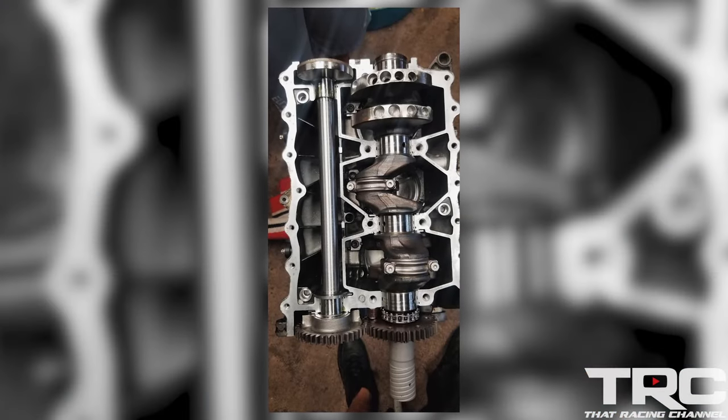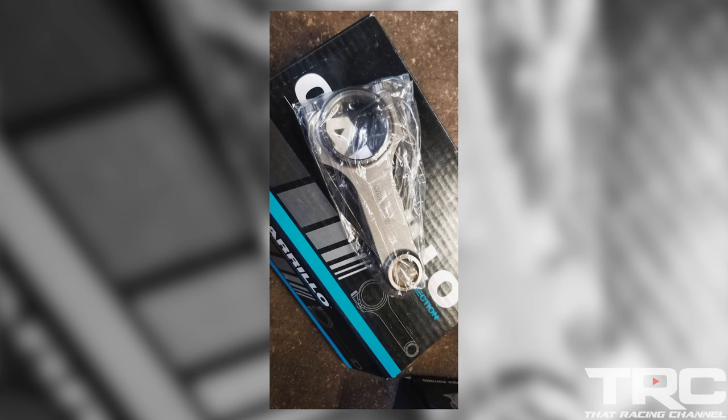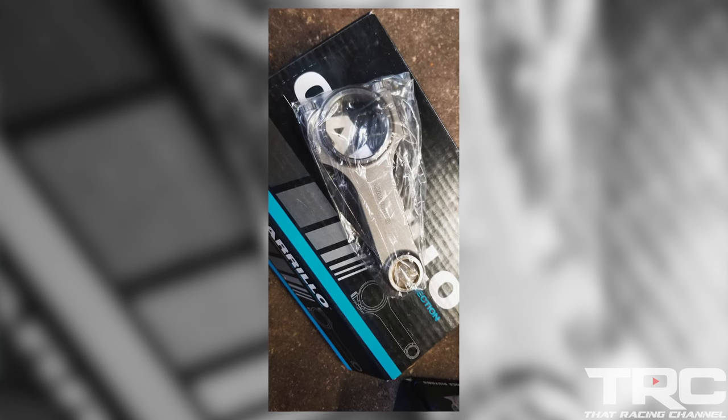We're gonna talk about my 2013 RXP-X 260 that happens to be turbocharged. All right guys, like the saying goes, we gotta start from the bottom. My block consists of a pinned and balanced crank that's connected to a set of Carrillo rods with a set of Carrillo pistons that are 9.5 to 1.